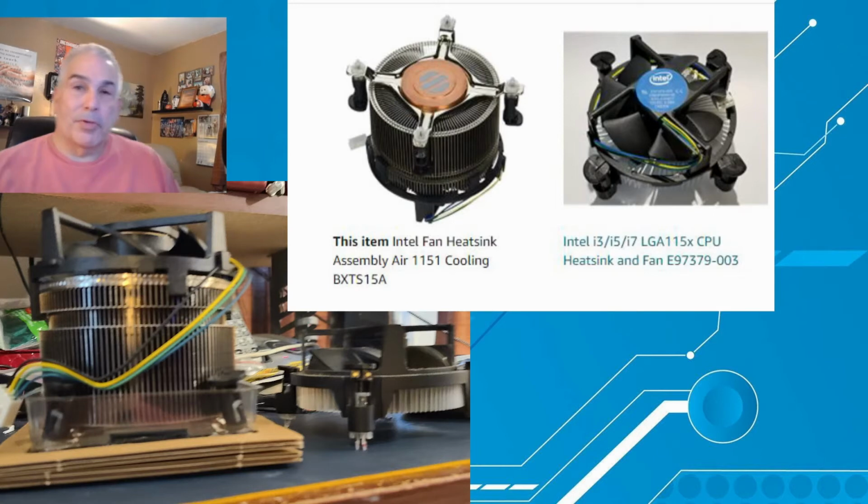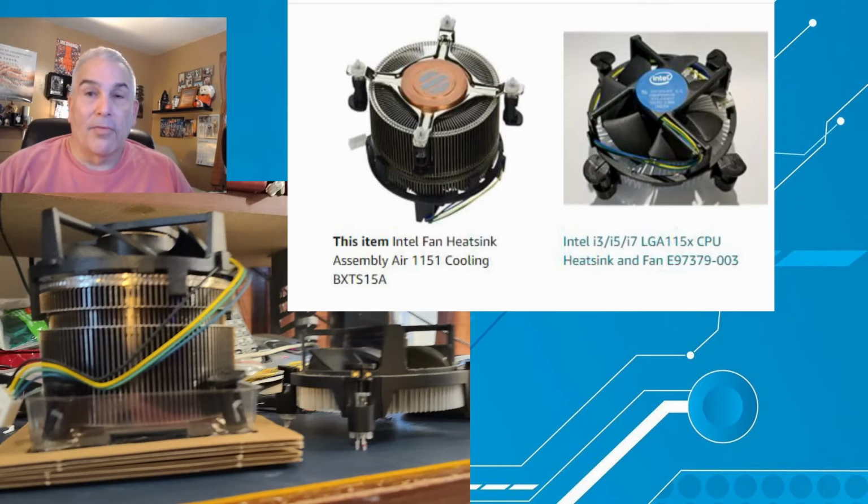Now, both of them are push-pin, and that was the problem that I had in my case. Either I had a choice of going to a much larger heat sink, but then I would have to take the motherboard out and put a mount behind it, which it could screw into, because there was nothing that I could find that was push-pin. Or I could put this in. And that did a great job. It did drop the temperature on the CPU when I'm rendering.